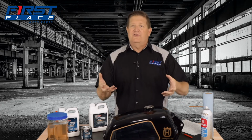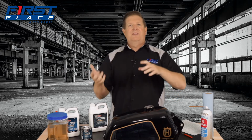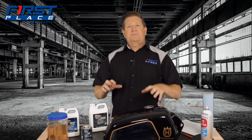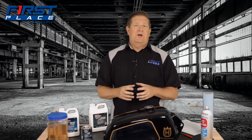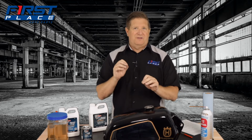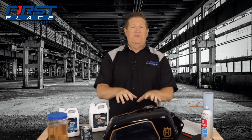Leave it on its side for 20 minutes, come back, flip it on its other side for 20 minutes. Front to back, prop it up. The top of the tank, we've got to get that as well. That's where a lot of your rust hides. And the metal prep will do a very good job of converting that rust to a more suitable surface. It doesn't get rid of the rust necessarily, but it changes the molecular structure of the rust. And what you're still going to have is a rough surface inside the tank.